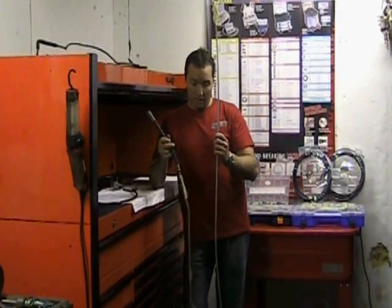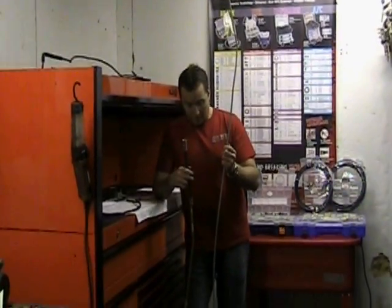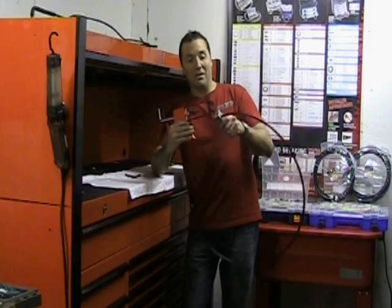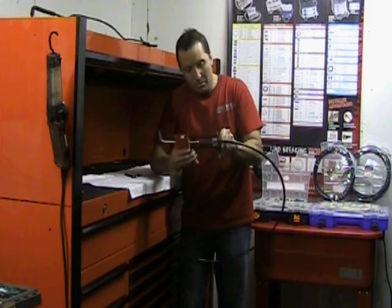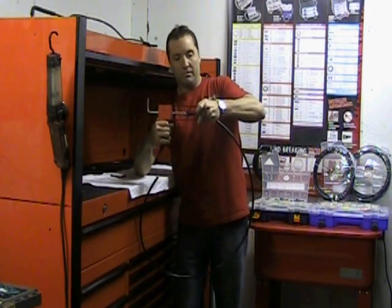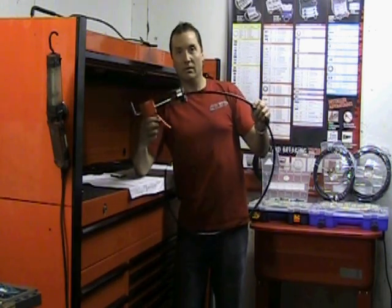You can order OE lines that are typically very expensive. When you order them, it may take hours or possible days to get, which is a very big waste of time. They're also very rigid and very difficult to route. And within about three years, you'll be replacing them again because they rust out since they're made out of steel. Try getting this underneath the car in tight spaces — it's not only awkward to use, you have to line the fitting up, put it in the clamp, and try to tighten it up. Okay, I think I made one fitting. Hopefully this one doesn't leak.